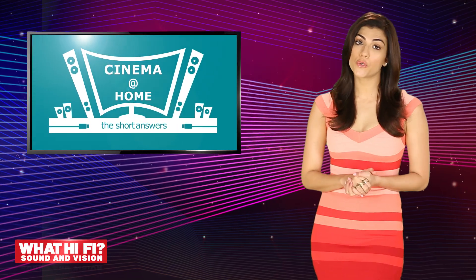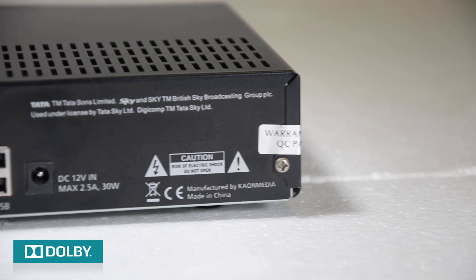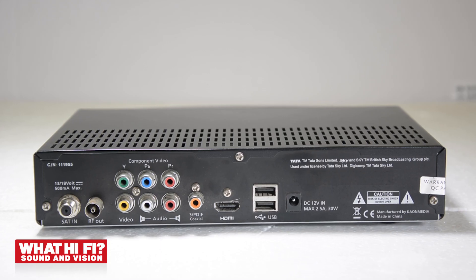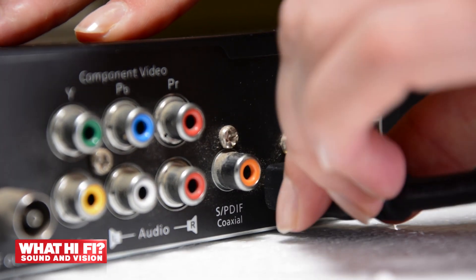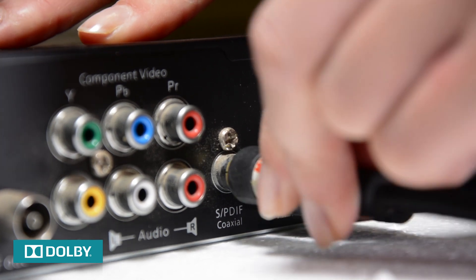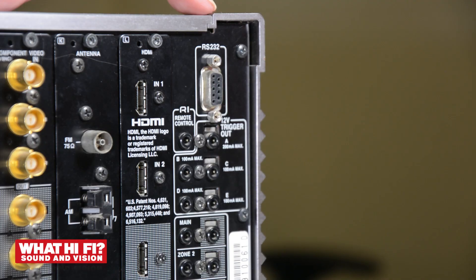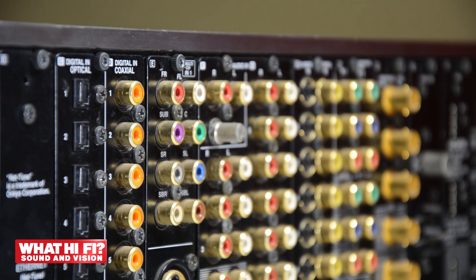So what's the easiest way to do this? Depending on who supplied your STB, it should have an HDMI port as well as an optical audio or coaxial digital audio port at the back. Click the link below to check out our video on the various connectivity ports used in home theatre. Connect the STB to your TV using the HDMI port, and use either the coaxial audio or the optical audio port to connect the set-top box to your AV receiver to get the full Dolby surround sound experience.